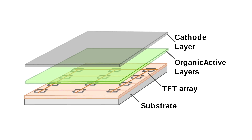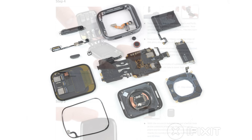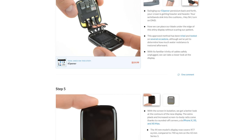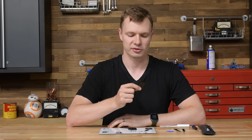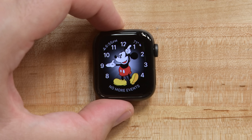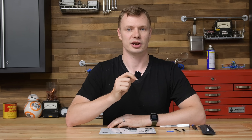This gives it some power savings, but actually it's not that new — the Apple Watch Series 4 had the same LTPO technology in it, but what it didn't have was Apple's ability to use their software and technology to change the refresh rate of the display. The refresh rate is basically how often the display looks for new content. If it's running at 60Hz, it's checking 60 times a second to see if there's something new to display. You don't need that when your watch is down by your side not doing anything, so Apple lowers the refresh rate down to 1Hz, or once per second — that's how often the second hand moves. That's a big power savings present in the Series 5 that wasn't in the Series 4.